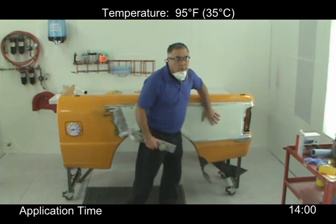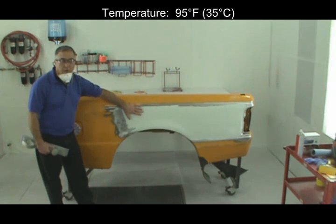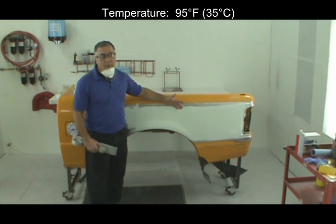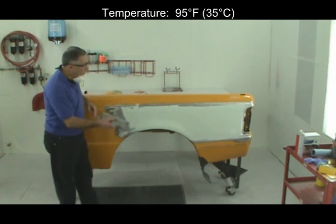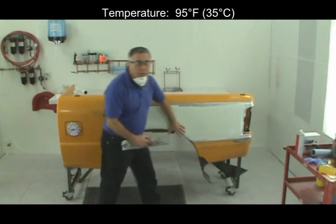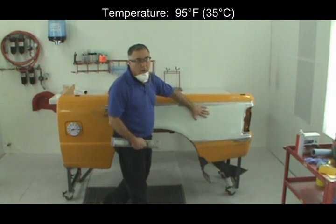From the beginning, I have about 14 to 15 minutes worth of time from when I applied this coat earlier. So in the 12 to 15 minute time frame, we anticipate that you can start to sand the filler in 12 to 15 minutes. I'm going to go ahead and start sanding up in this area and work my way down. You can see this area hardened up quicker — I only put one coat of filler over here, didn't put a secondary coat on.